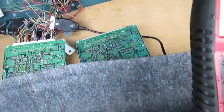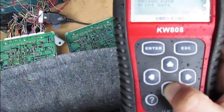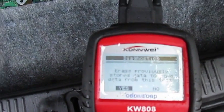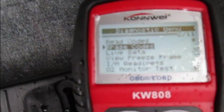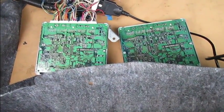Let's go to diagnostics — I'm going to connect to the vehicle. Actually, that's another difference: on this one I didn't erase, I didn't remove the ability for those codes to come up. But as you can see, vehicle ID number — there's that same VIN number. So these two ECUs are cloned and they no longer have immobilizers.